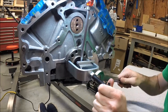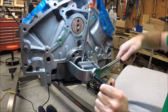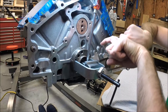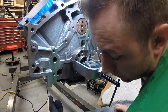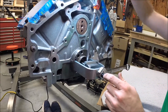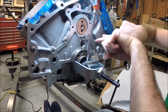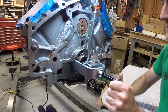What you don't know is that I've been fighting with this thing for quite a while and I destroyed the bearings on the inside. Part of the problem is this tool just doesn't get a good bite inside that bearing, so it kept pulling through. Here's the inner cage — I got all the needle bearings out, and then I even wedged a flathead screwdriver down between the two fingers just to keep them from pushing inward as there's pressure pulling it out, just to make sure it gets a good bite. And it's finally starting to come out.